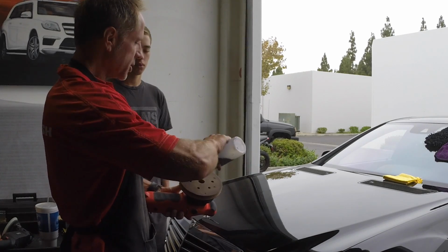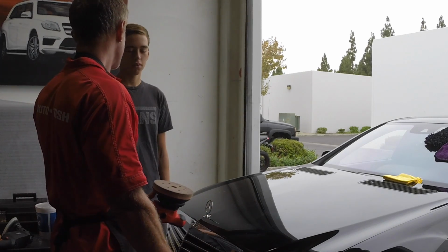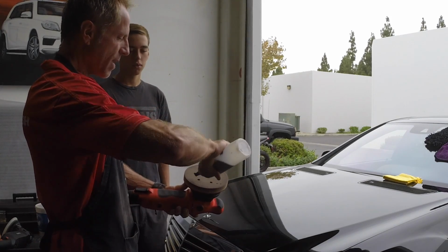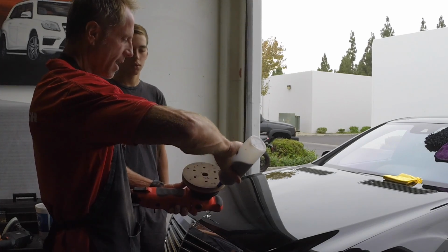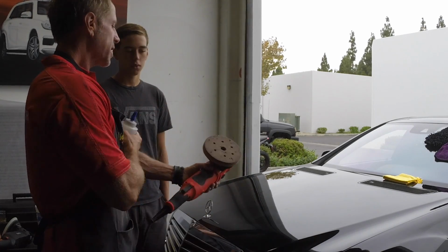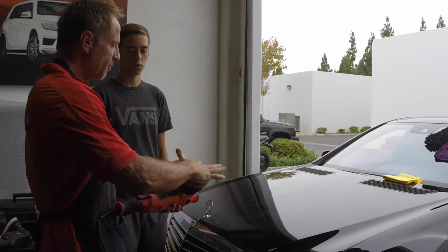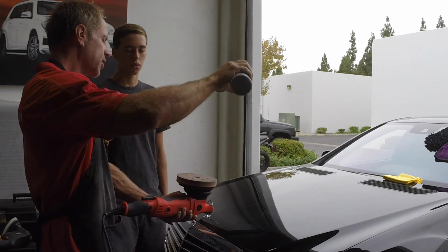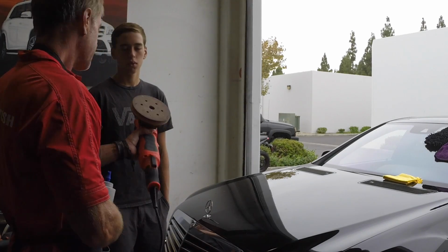And this is what the industry calls seasoning the pad, which I'm not a big fan of, because every time I see someone on video season a pad, they use too much polish. So I'll just sit here and you can make lines in it, draw a little happy face, whatever. What essentially you're trying to do is disperse polish around this pad kind of evenly rather than just a big glob in the middle. But honestly, that's where guys overthink it.